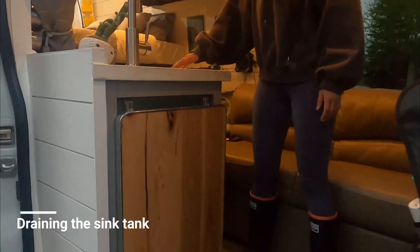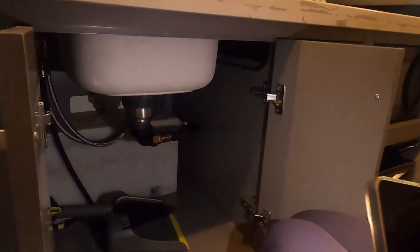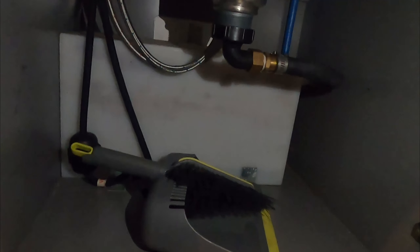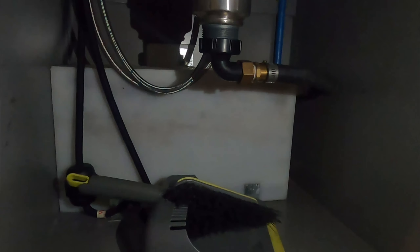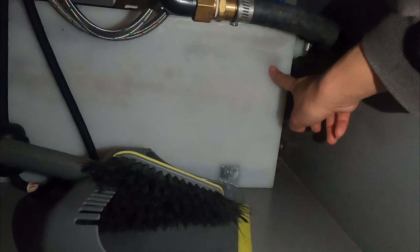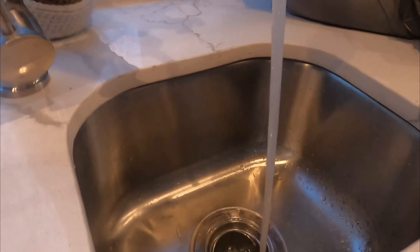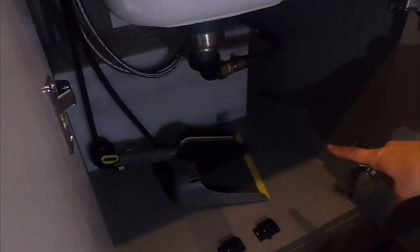This is how we drain the water from the gray tank. Below the sink there is a five or eight gallon gray tank. When you're in a place where you can't really dump the water, you can close the valve and all the water will be saved up here. You can actually see the water line about here right now. Once it gets a little bit full, you'll start seeing more water in your sink. We'll show you how to drain that little tank — let's open the water. The valve is actually closed right now and you can see the wastewater keeps going up. Now I'm going to close it and show you how to drain that tank.